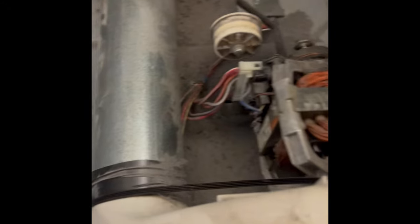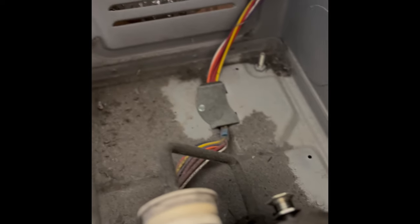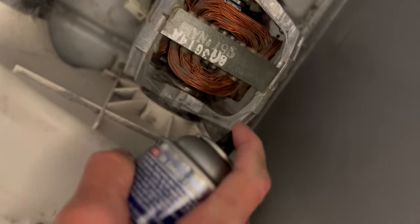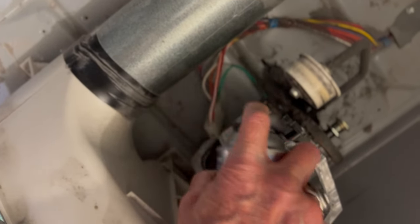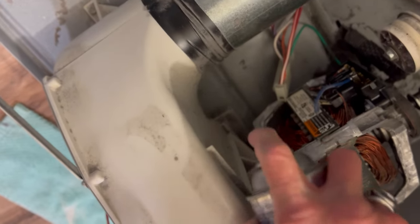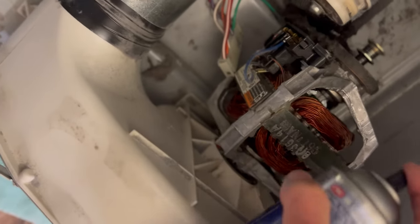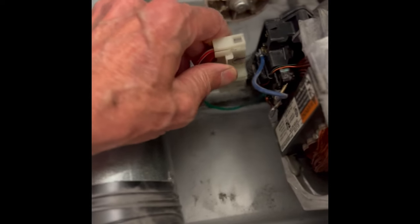The motor is pretty dirty — it's just lint that's accumulated over time, and it can get in the way of the motor being able to keep itself cool. If it overheats it'll just shut off. Note: if you're losing heat mid-cycle, that's a different problem. Here's some electrical contact cleaner you can get from Home Depot in the electronics section. I'm going to use that to clean up the motor. I've already vacuumed it pretty well to get rid of most of the lint, and this stuff is just going to get into the places the vacuum can't reach and knock dust away from the cooling fins.